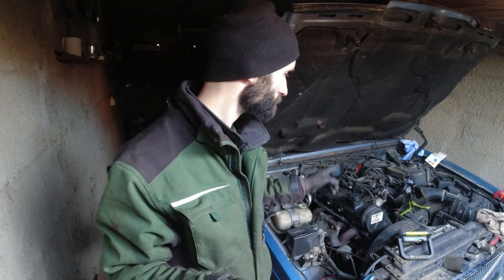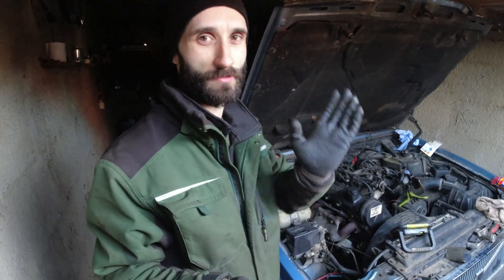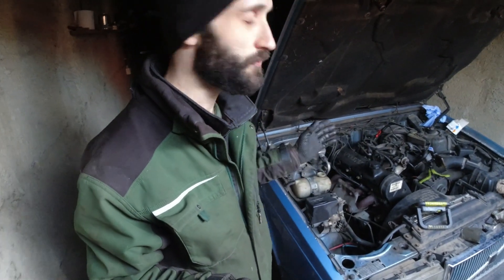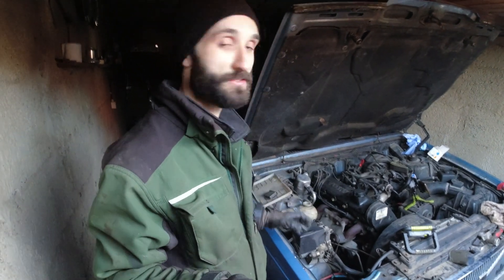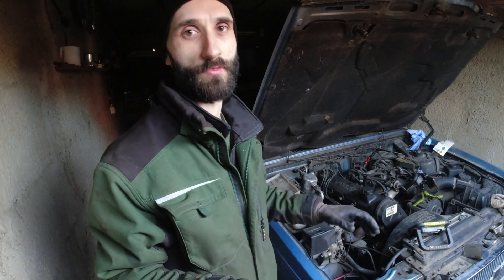The hoses look okay but they've got some age to them. She's actually running slightly cold — the gauge doesn't get up to halfway. I've only run it a couple of times but there are a few things it could be, and the thermostat could also be a factor. In any case we just need to crack into the cooling system. I'd feel so much better with a new thermostat I can rely on, some fresh hoses, fresh coolant, and then we know we're good to go.